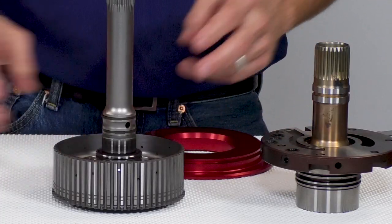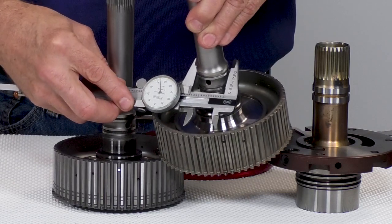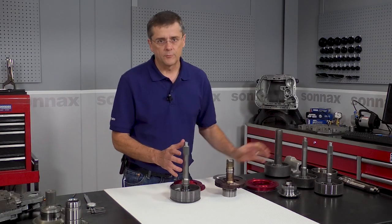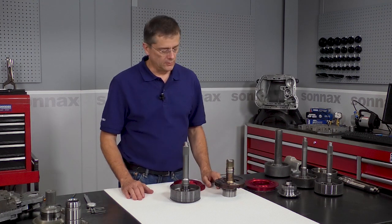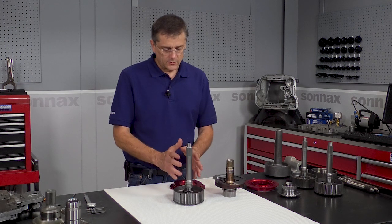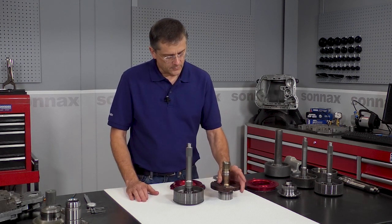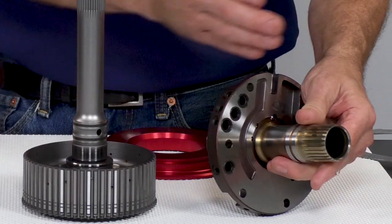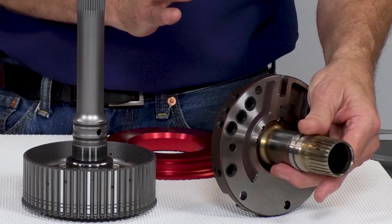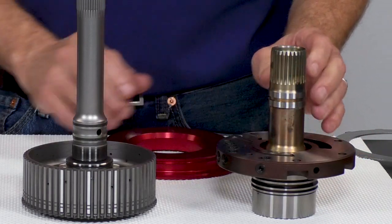And it's a full hundred thousandths larger in diameter at the sealing ring area — you can see that big difference in area. That makes the whole shaft 35% stronger than even the best heavy-duty shafts. Now to do this, to get this to work in the unit, does require a special custom stator assembly. This is a really special piece — all custom made, very precise. It's going to keep all your parts in perfect alignment and seal everything up real well with the added seals.